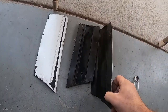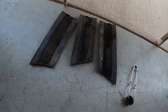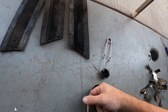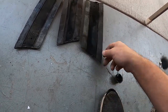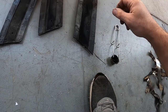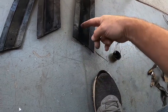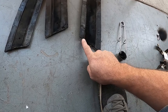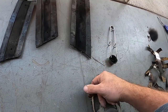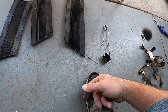So all of these here came off just fine. Like I said, once you put a little bit of heat on — a smaller torch, a propane torch like one you would use for plumbing with a little tank — works really good for this. You heat them up a little bit and you kind of want to watch that you don't melt your edges, which was kind of hard with the acetylene torch because it shot out so much temperature at one time.